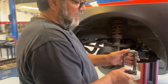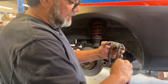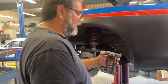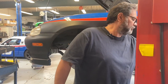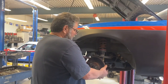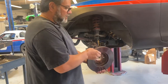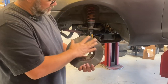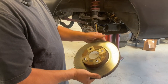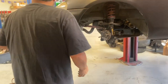I'll pull the bolts out and there's the bracket. I like to put these right back where they came off so I don't lose them - I teach high school auto here, and you'd be surprised how many times the kids lose those bolts. I'll set that aside. Now I can just slide the rotor off. Here's the rotor - it's still in pretty good shape. No cracks, no hot spots, hasn't been metal to metal, doesn't have a really big lip. We could probably turn this rotor and reuse it.